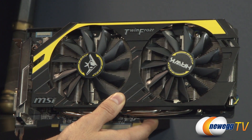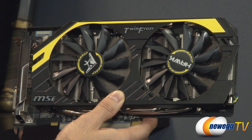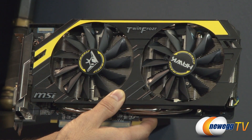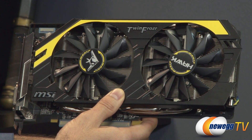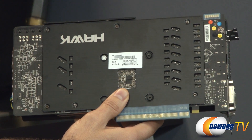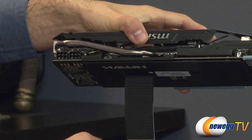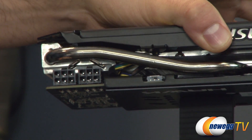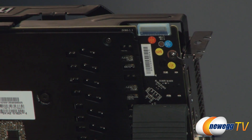The GPU it's cooling is a 28nm Pitcairn graphics chip — the same architecture as the HD 7870 and 7850 — with 1280 shader processors, 32 raster operators, a core clock of 1100MHz, and a boost clock of 1150MHz according to MSI, compared to the stock 270X core clock of 1050MHz. Memory is 2048MB of GDDR5 at 1400 mega-transfers per second, quad-pumped for 5600 mega-transfers per second effective, with a 256-bit memory interface. Up top is the BIOS switch to toggle between LN2 and default BIOS, and to the left are the two six-pin PEG connectors. On the other side is the two-way CrossFire finger connector.